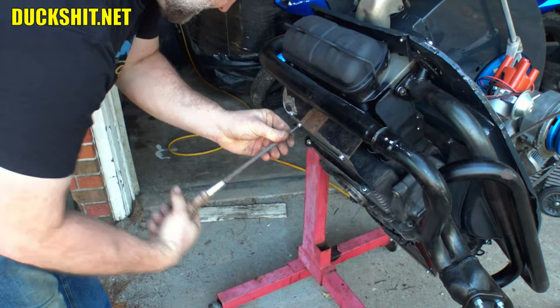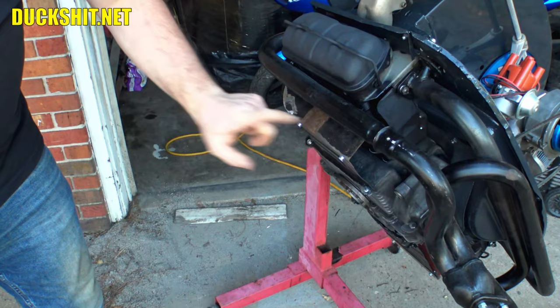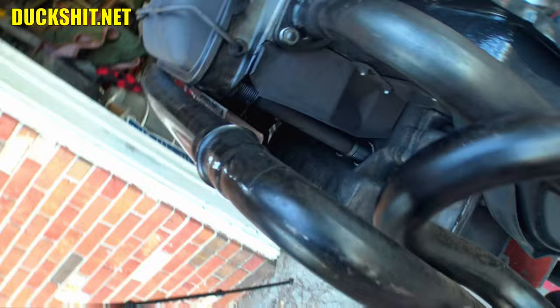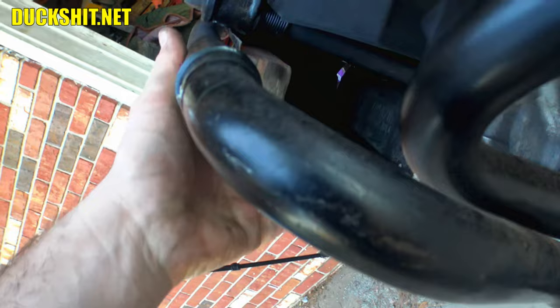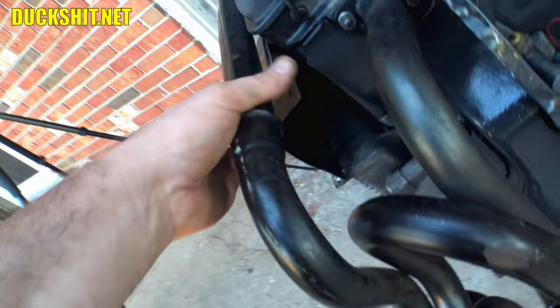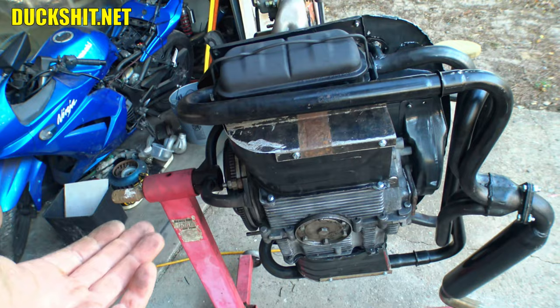Okay, that's in there. Looks like we're secure. I like that it doesn't rattle or ring. There it is — wrapped around. There's that scallop cut that I was telling you about over here on the side. I cut it just a little long; I could zing it off if I want to, if I even care. The whole idea was to keep the radiant heat from the exhaust out of the pushrod tubes — you don't want it to heat up your oil. I could probably bend this a little bit better. This was just sagging a little bit and pulling down the industrial tin that I made. I could have just bought a set of these for $30, but I made them in about 30 minutes — three bends each and just a couple cuts, a few measurements. It wasn't hard at all.